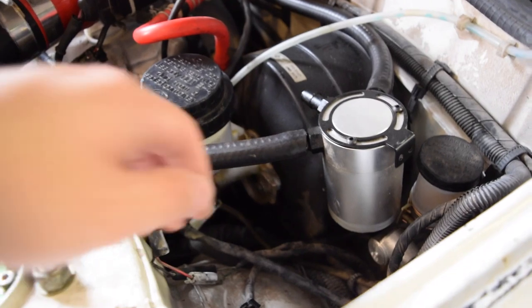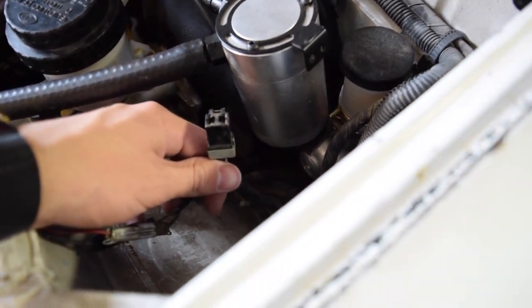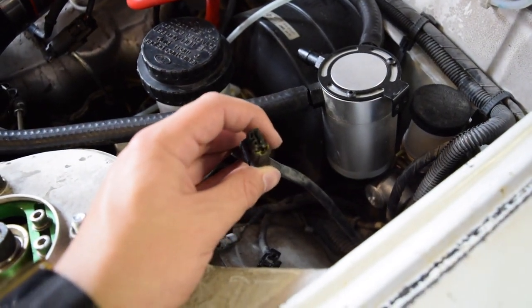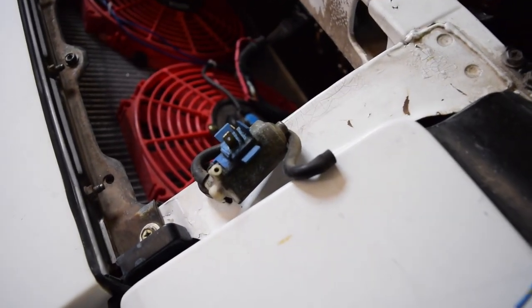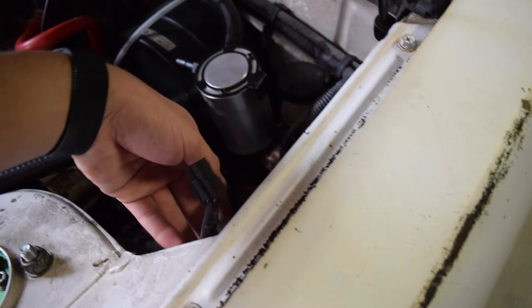I believe I misspoke earlier. I said this bundle of wires was the front pump and back pump wires — this one on the right is actually the level sender; you can tell because there are two parallel connectors. This wire right here is actually the pump for the front, and it's got a 90-degree orientation between the pins — one is flat and one is straight up and down. That's perfect because our new pumps are the exact same way. Also I misspoke: this is not the rear pump, this is the front pump. You can tell because it's got the 90-degree connectors; the back pump we had to cut the wires off of because it doesn't have a connector. We're going to be able to plug the front pump in just fine using this old connector — it fits perfectly.